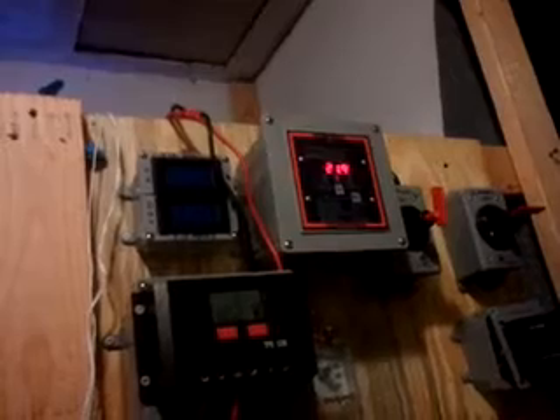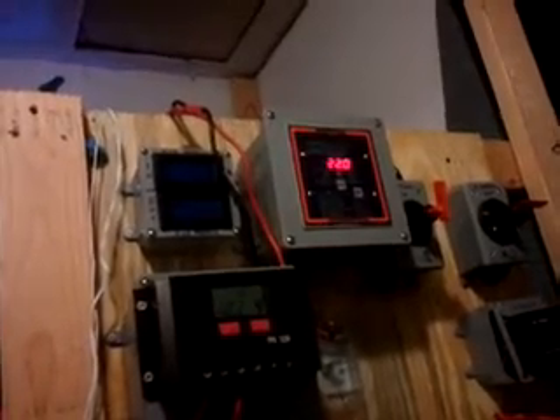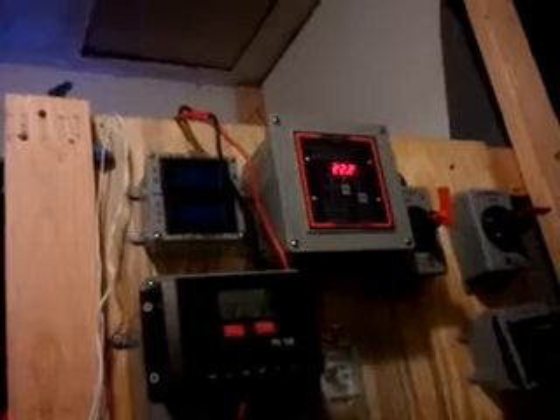Now you slowly notice the battery voltage starts to drop, which typically happens immediately as soon as you hit power on anything. Because of the supercapacitors, it does not have to. This means longer life for your batteries and less draw all at one time. That quick start is what deep cycle batteries aren't designed for — they're meant to give a long burst of energy. You can damage and sulfate your batteries badly if they're pulled hard all at once, and the supercapacitors prevent that.